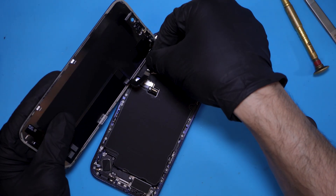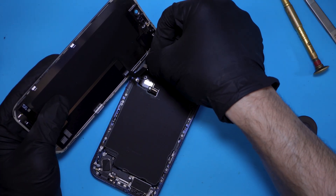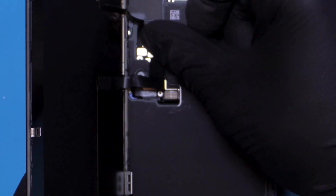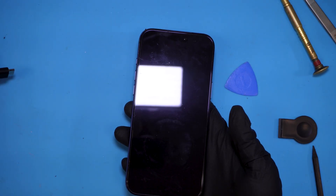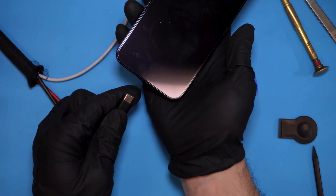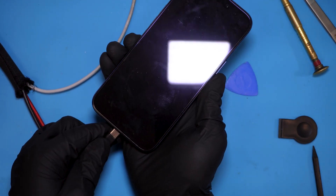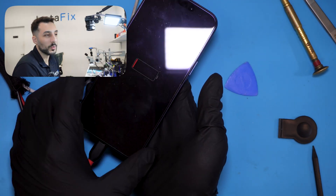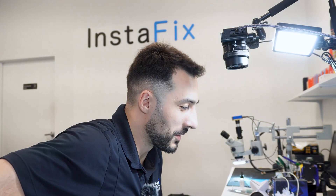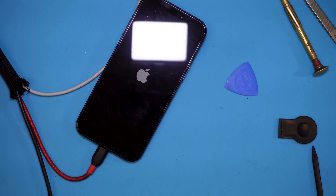If you're doing this yourself, this can probably save you some money and hard time. Battery connected, screen is connected. Let's go ahead and throw this on the charger and read what the charger says, because earlier it was showing 0.48 amp draw and then it turns off. We got it! Let's go! That's all it needed — just unplug the screen, the battery, and replug it.